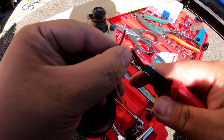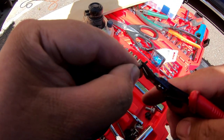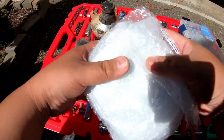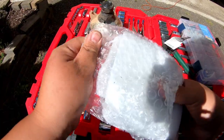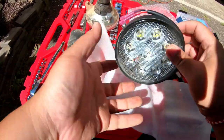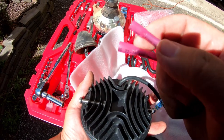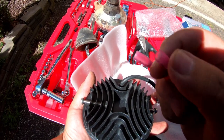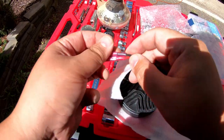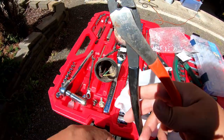I'm just going to strip the green wire and then the black wire. So this is the LED light — as you can see it's already pretty wired for you, it's already got the connectors. These are the connectors that you want. When you crimp it, you can use the heat gun to shrink the sides — it also gives a more waterproof connection. And for clamping, make sure you get one like this. This is one of the best clamps out there.